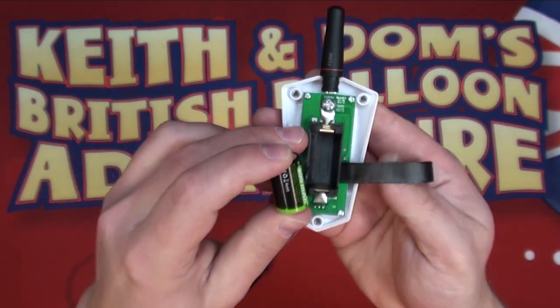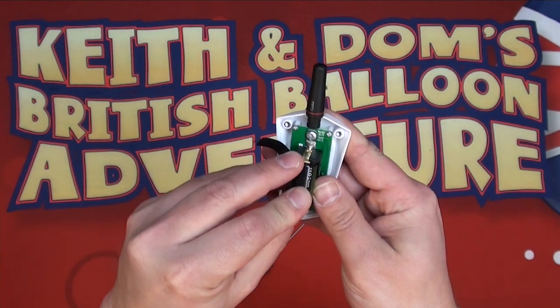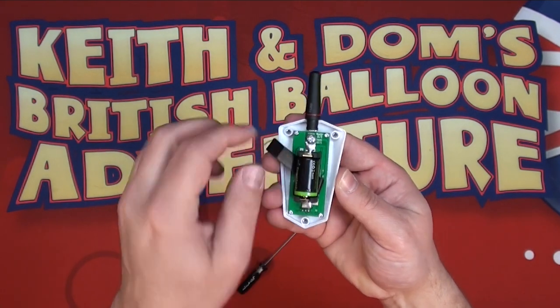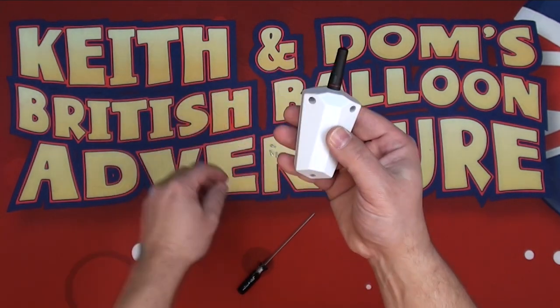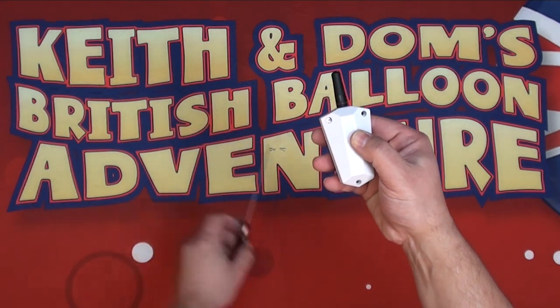Before putting the battery into the unit, push the ribbon over and then place the battery over the ribbon — this will aid the removal of the battery later. Push firmly down on the battery until you hear it click into position. Push the ribbon out of the way before putting the rear casing back onto the unit, then carefully replace the three machine screws using the hex driver.